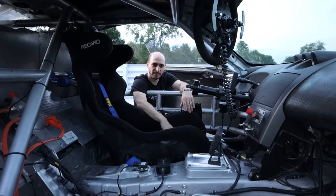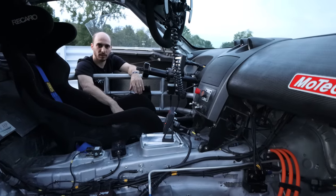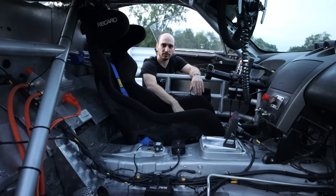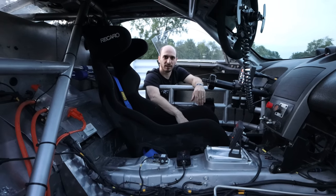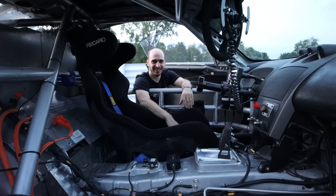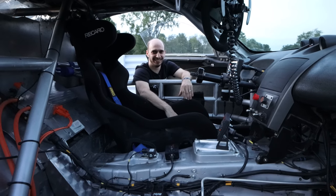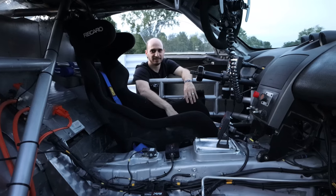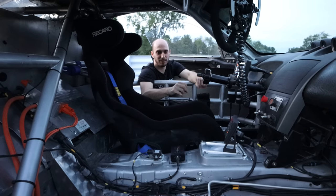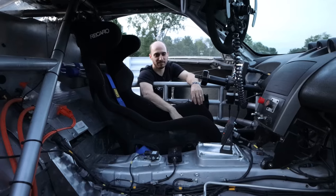It's just so cool to me that you've developed this, because this would only work with a hybrid without a clutch. Yeah, you have to start. Yeah, exactly. I mean, what this reminds me of is those winged sprint cars, direct drive, you have to be rolling. Right. Then you can get it into gear. That's right. Or you have to get pushed by something. That's right, yeah. So the electric motor turns the motor, starts the motor. It's the engine spinning the whole time, but the ignition and fuel are off until you get enough RPM, and then it lights up. Yeah, that is the coolest thing.